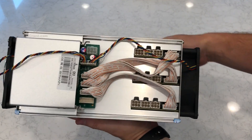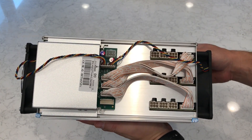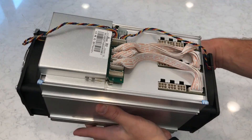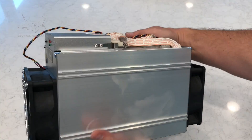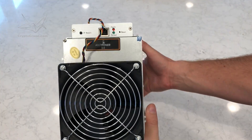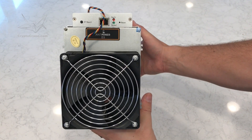As you can see here, you'll need a power supply that has at least ten 6-pin PCIe power connectors — that's three for each of the three hashing boards and one more for the controller. The D3 has dual 120mm high airflow fans, one for intake and one for exhaust.